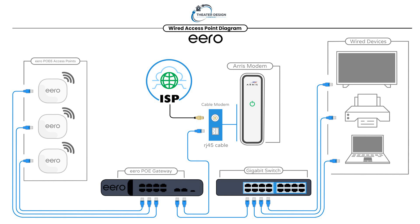So let's get to the gist of this. What you've got here is the internet service provider — we're using this as a Comcast scenario. They're going to be doing RG6 into the cable modem. A quick snippet on why we recommend buying your own modem: the main reason is obviously cost savings. Second, if you use Xfinity, they will give you the X5 modem and you're going to have to put that in what's called bridge mode to make this work correctly. If you call Xfinity and you have any troubles, they often send signals and just reset these modems and pull them out of bridge mode. You can run these without bridge mode; however, if you're a heavy gamer or have security cameras, you don't want both this and the Comcast X5 acting as a router — that's called a double NAT, and it's not advised.